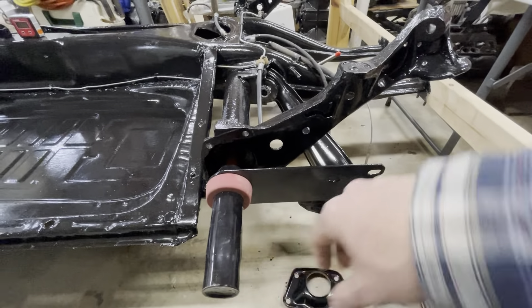We're talking about the torsion tubes and the torsion springs. The easiest way to explain it: there are three central components to the rear suspension. There is the main torsion tube, which runs from the outer edge to the inner edge. Then there's a torsion bar, which is basically just a steel bar manufactured with a certain spring rate — as it twists it will spring back, so it is a spring in itself. The third piece is the torsion spring plate. The torsion bar has splines at either end, and there are actually two different numbers of splines.